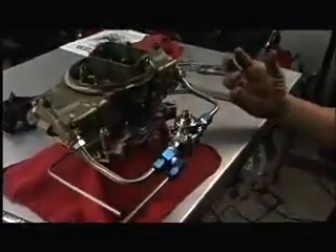At this point we're going to mount the regulator off of our carburetor. The cleanest, most sanitary way to do it is to start out with some stainless steel 3/8 tubing. What you do is bend the tubing to fit into your regulator — this is the Holley regulator. When all is said and done, when you're done screwing it together with your carburetor, it's amazing how strong this is. It actually doesn't require a bracket if you use the stainless steel lines.